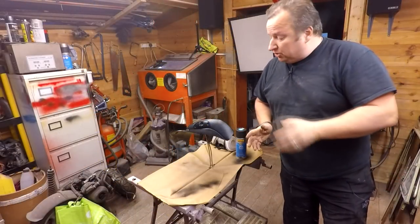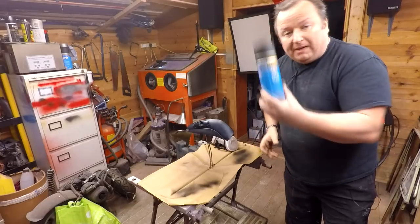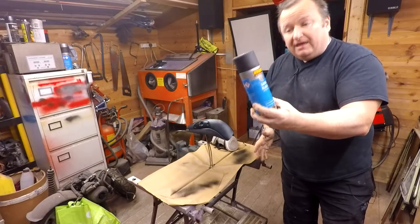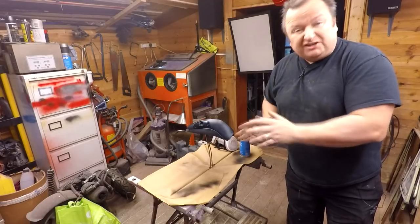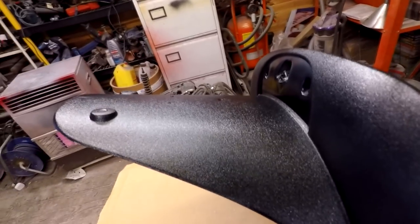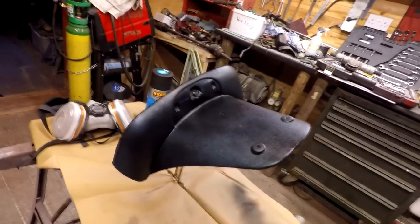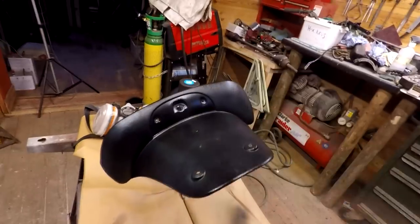Right, okay — what we've done there is we've given it two coats of the plastic primer. I've just gone over with a fine dusting of our black first — this is the same black we actually painted the motorcycle bodywork in. It's a satin finish, not high gloss, but it's achieved the sort of finish that I want. As you can see, it's a textured surface — like a plasticky textured surface — but that is the actual finish I'm looking for. We've only got one coat there at the moment, but that's the black we're going for to match in with the bodywork.